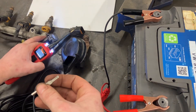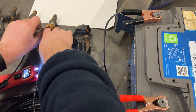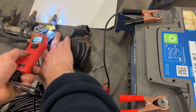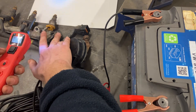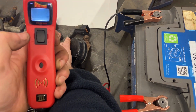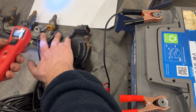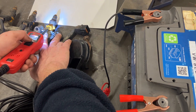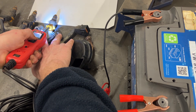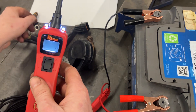Here's a fuel injector to demonstrate — it has two wires. I'm going to put my negative on one terminal and the positive probe on the other. The power probe lights up showing the circuit is negatively charged, because the negative wire from the battery is connected. You can use the rocker switch to add positive or negative and it will automatically tell you what the circuit is. I push the button and — hopefully you could hear that clicking — the fuel injector is working, with the clicking noise of the solenoid opening and closing.